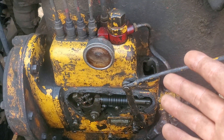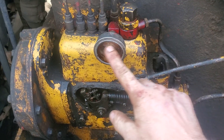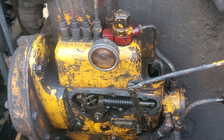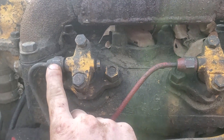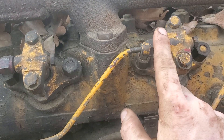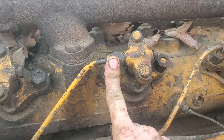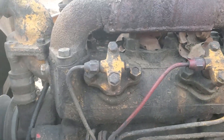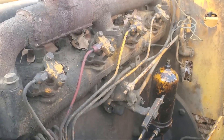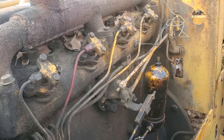The things I've gone through so far: I could get it fired on gasoline, no problem — it would run and I would show a little bit of pressure on the gauge, but I was told this gauge really doesn't mean much for actual fuel pressure. I was getting fuel at each one of the injectors. There was one right here that was barely drizzling out, and the others were coming out in a good steady stream, like a garden hose just in the on position — not like a fire hose as people were telling me it should be.